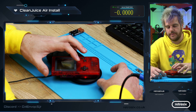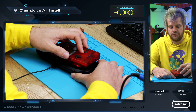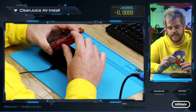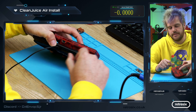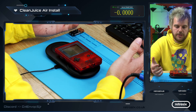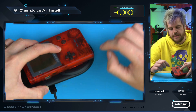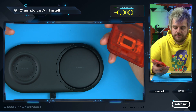Some chargers have an indicator light, some don't. If yours doesn't, you can look at the Game Boy itself. You'll see an orange LED — which looks red through the shell — next to the D-pad, meaning the battery is charging. There's also an LED under the headphone jack, which indicates the wireless receiver is receiving power. The LED near the headphone jack means the transmitter and receiver are working together; the LED by the D-pad means the battery is actually being charged. It takes about an hour to an hour and a half to fully charge from flat. Once done, the charger light will go off or turn green and the orange D-pad LED will turn off. If that light turns off but your charger stays on, remove it from the stand to avoid wasting energy.